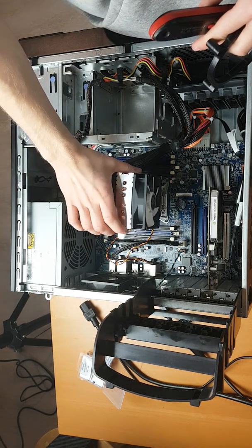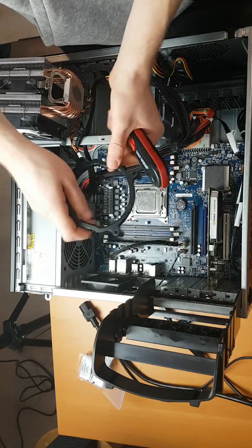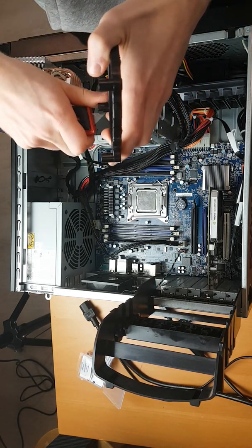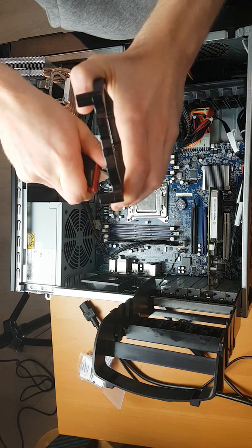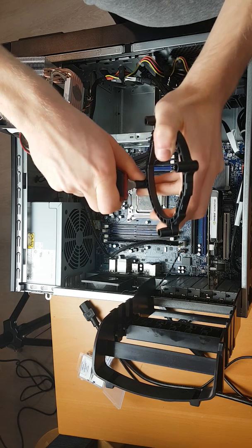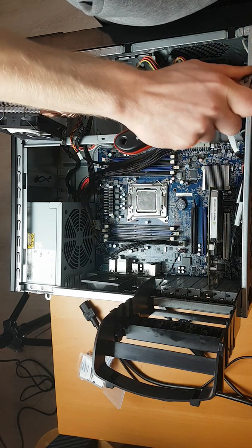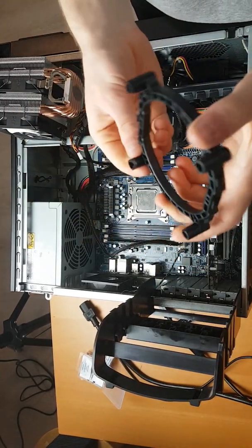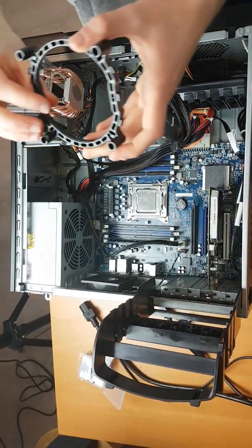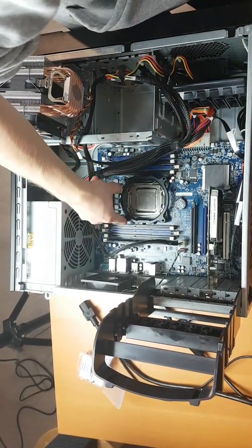That's how I want the orientation of the CPU cooler to go onto the motherboard here, so that means I need to have my two retention clips on either side. I just have to quickly cut away a bit here. You generally want to be more careful than this and not cut towards your finger. It's soft plastic so it cuts pretty easily. Don't want to do it in the camera shot in case I do cut myself — that would look silly. You just want to be really careful to get this to fit properly. There we go — I took a good chunk out. It fits perfectly now. That's a quick hack you can do: just grab an X-Acto knife and cut it a little bit.